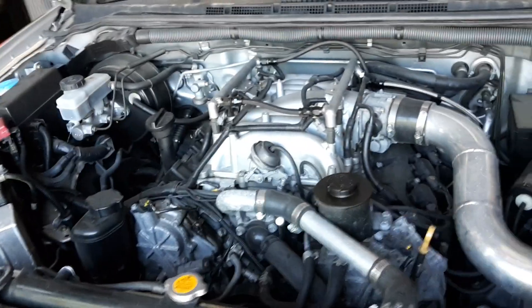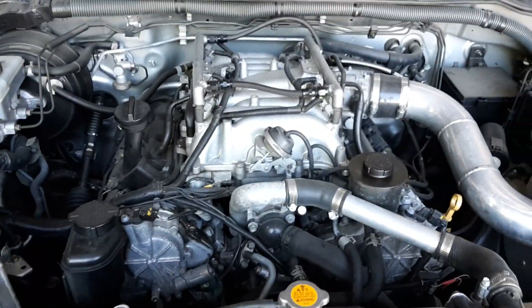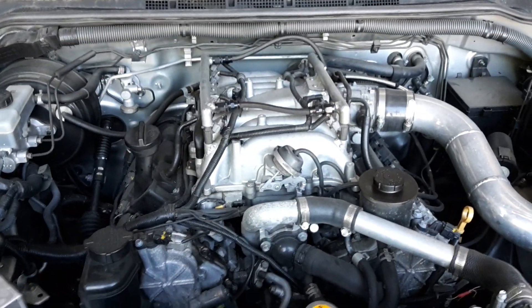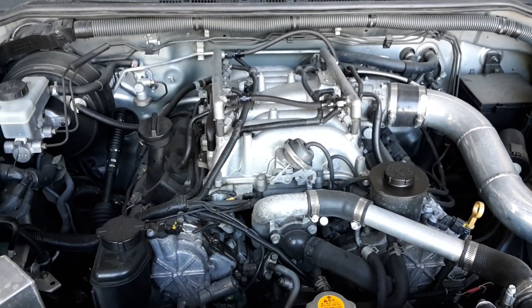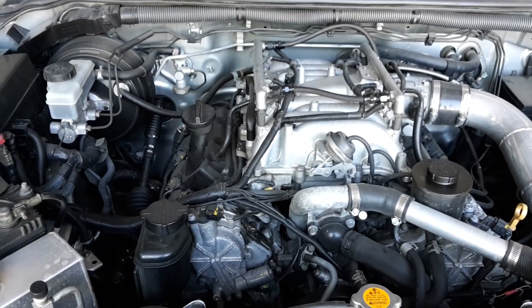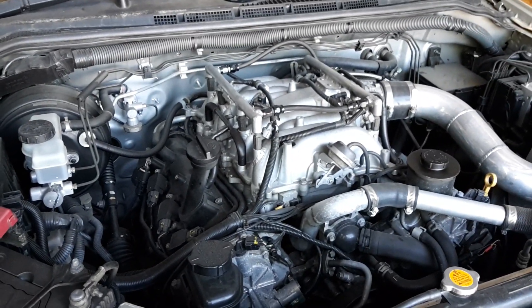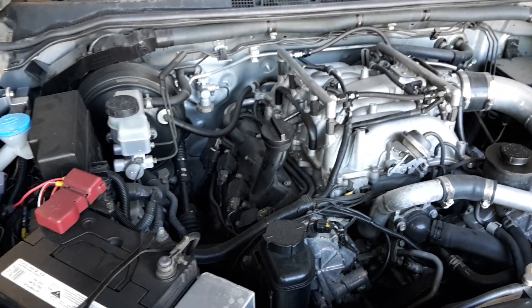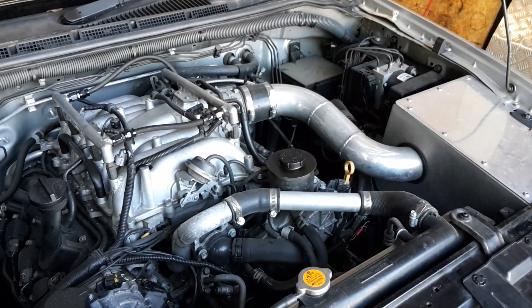If we tried to get really clever, we could have used the direct injection system running an aftermarket pump to get the fuel supply, because the factory fuel pump was on the back of the head and would have clashed into the firewall — so we had to take that off anyway. We probably would have had to run two Link GDI direct injection ECUs to run one motor, and that can get messy. It can work, but it can also get messy, so we decided against that.